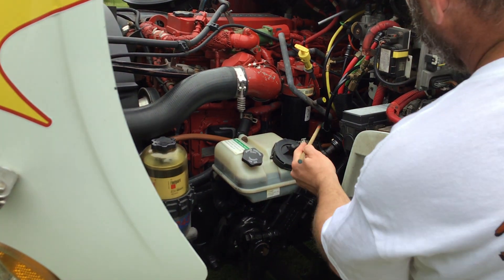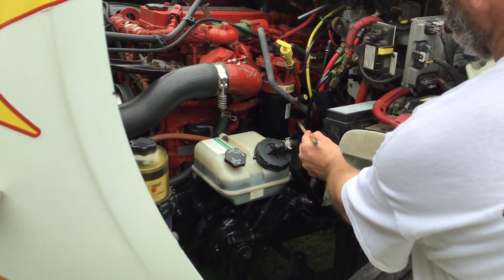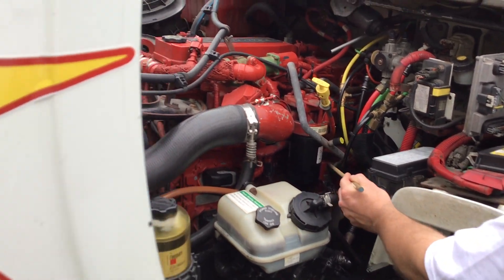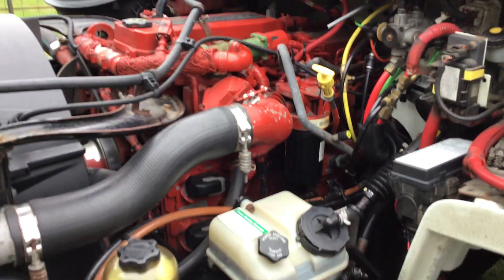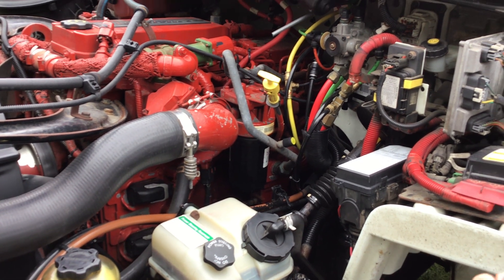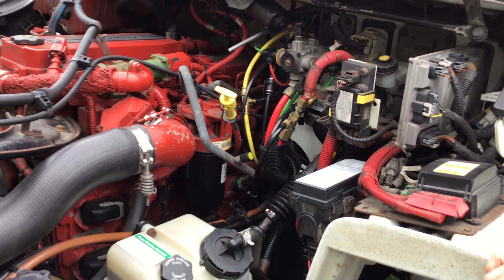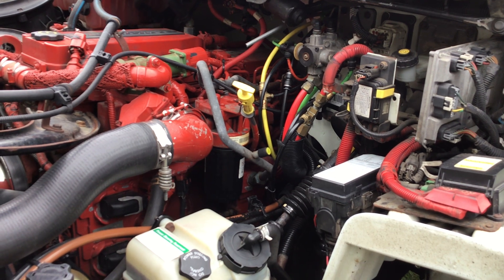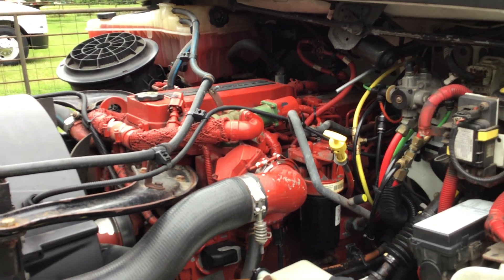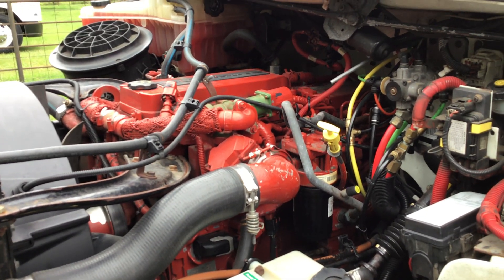From there, we'll go to the air compressor. My air compressor is gear driven. It's properly mounted and secured. All nuts and bolts are present and tight. It's not cracked, bent, or broken, and it's not leaking. All hoses leading to and from my air compressor are properly mounted and secured. All hose clamps and fittings are present and tight. They have no abrasions, bulges, or cuts, and they are also not leaking.